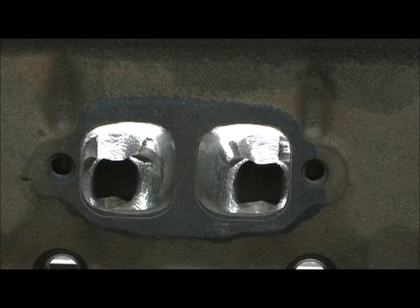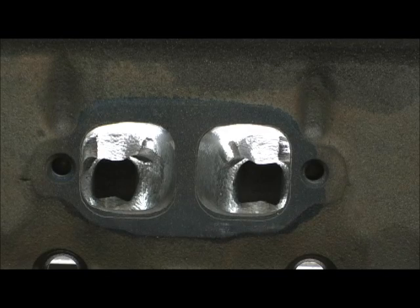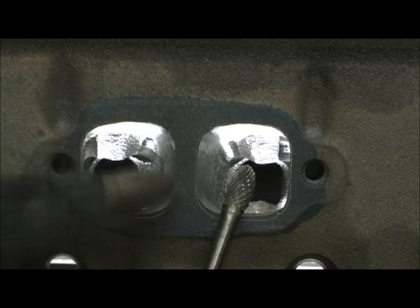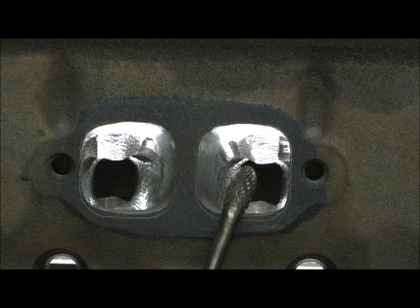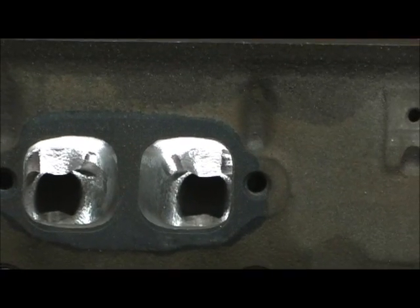The point I'm trying to make is: when we get to a point where we've used that one particular raw material cutter, this saves you time switching burrs all the time. Your consistency is going to be a lot better when you stay cutting the same mod on all the ports instead of trying to switch and do a port at a time — which is very crazy to do. So we're going to switch to this baby burr, finish the exhaust, go back to the intake, and continue on the intake side: the bowls, the blending, and pulling it all in. That's all for now and we'll continue on with the intake port with the conclusion of the TBI Throttle Body Heads.